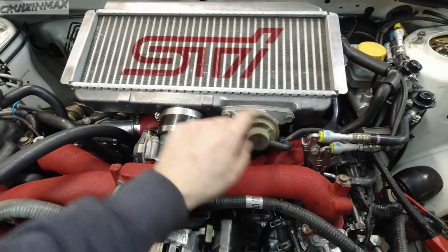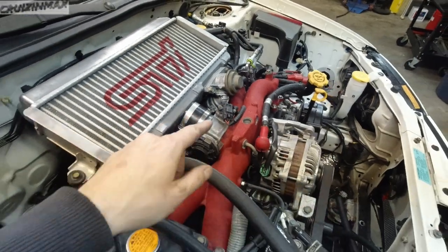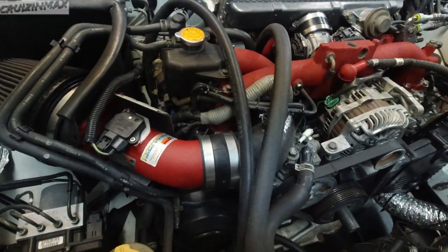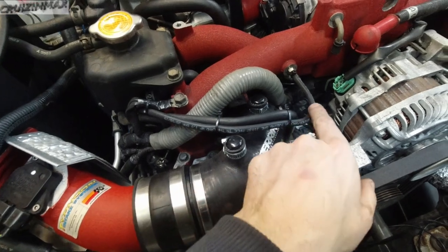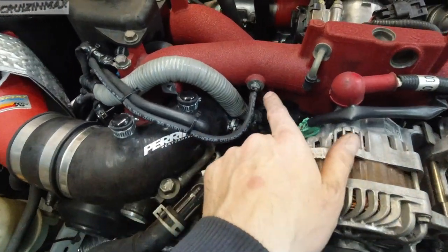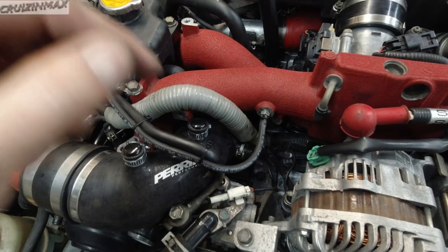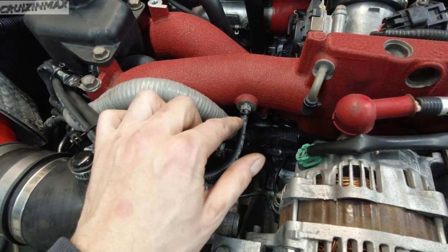I just torqued these two down to 11.7. So you just saw me install the intercooler — two clamps on here. I got a new pipe over here because I used the one that was there and I just noticed I needed one for here. Two clamps for this elbow pipe here and two mounting points for the intercooler. I did change — remember this little hose was going underneath the intake and up to here. I decided to go this route here simply because I felt like I can secure it better right over here. And this factory nipple — what I did, I made a little flange. I heated up the tip and knocked in a nail ever so slightly to open up the opening of the nipple just to flange it a bit.